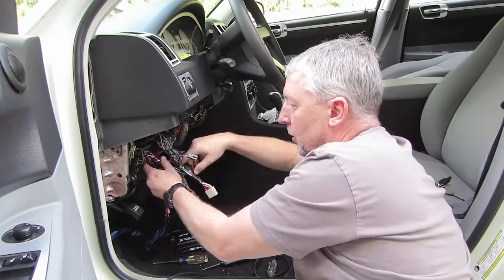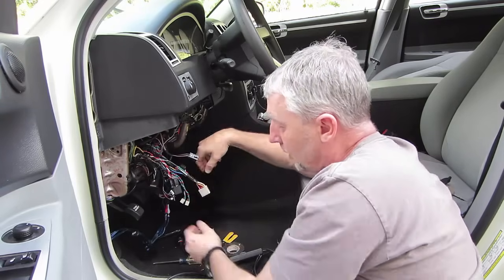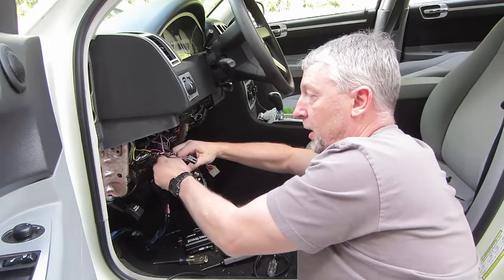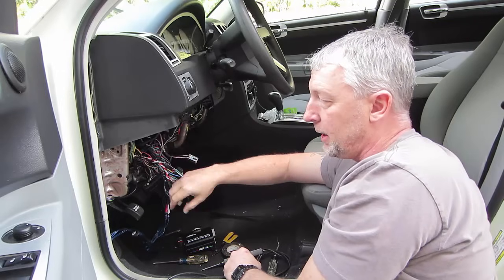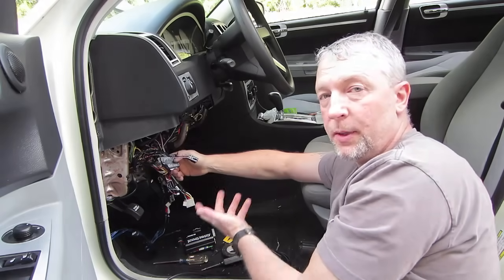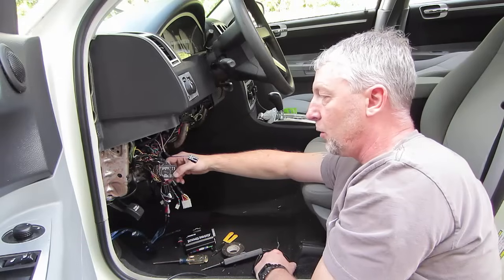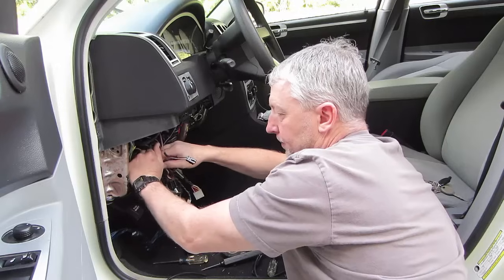Now, in here, if you start following along some of this wiring, you're going to find some other stuff. Like in this car here, you have this box. This is pretty common in almost any system installation these days. This here is an iDatalink ADS-ALCA, which is a CAN bus interface which handles door locks, dome light supervision, trunk release, factory security, immobilizer bypass, all kinds of stuff. This little box. So again, unplug it.